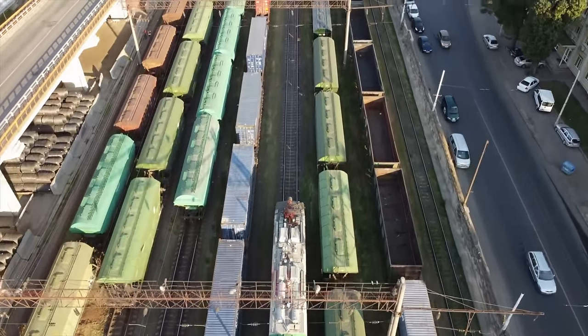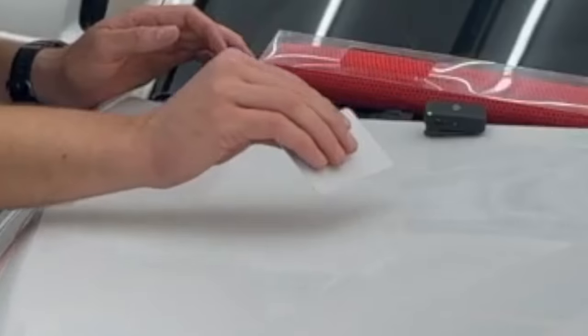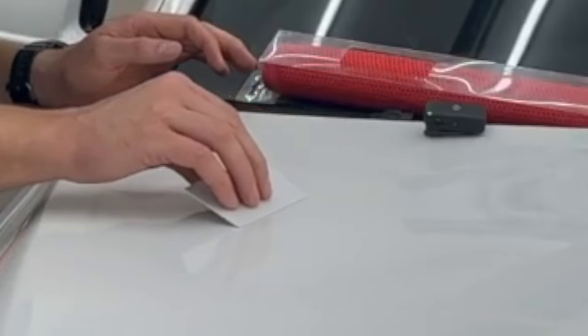There are a couple of ways to feel contamination. With your naked hand, you really don't feel it much unless it's very bad. One way: put your hand in a plastic bag and feel through the bag — you'll feel little bumps, and that's the contamination. Another way: just take your credit card with no pressure, hold it lightly and drag it along a clean surface. You'll actually hear and feel the contamination. Once you decontaminate, do that again and it'll be a nice smooth surface.